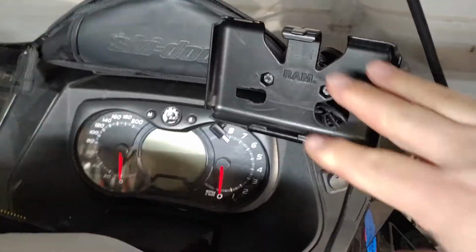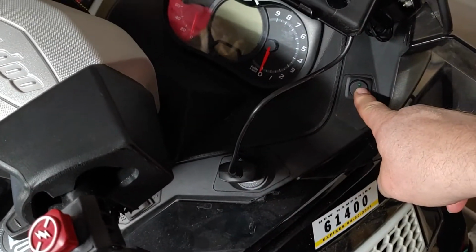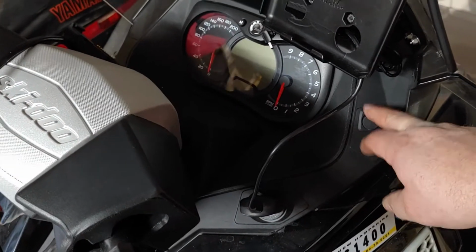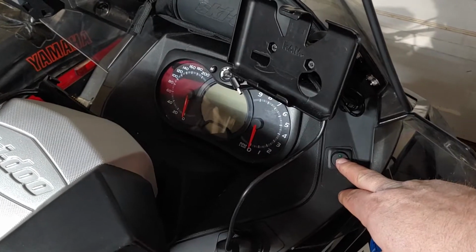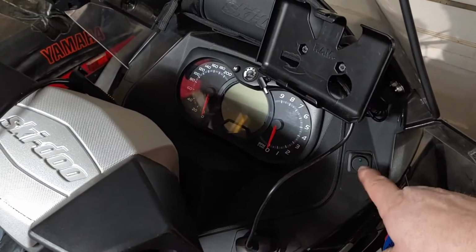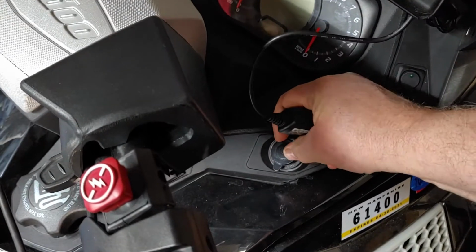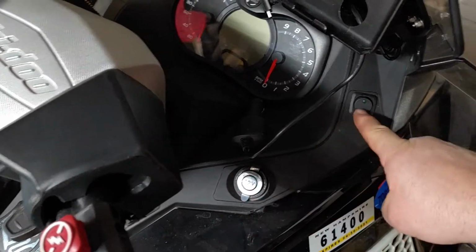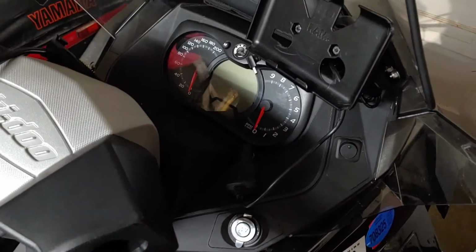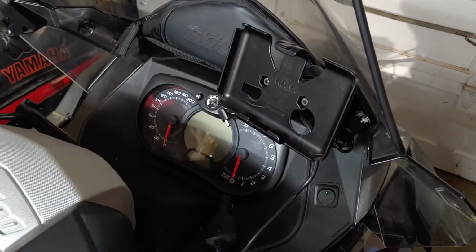The other thing I have to do is I have to change the wiring to this. Originally I had it going into the socket, from the socket to my switch, and from the switch to the battery. So this way I can turn the system on and off from my switch, and when it's on, it is backlit. So I've decided to change that. I'm going to go from here in, and I'm going to splice into this, which means the 12-volt socket here will continue to work, but it'll only work when this is on. Okay, so both will be drawing from the battery. So I could actually charge my phone from that if I wanted to. Most likely I will not, but that's the way I'm going to do the setup. So I'm going to record swapping this out.